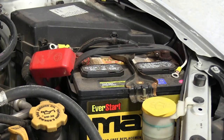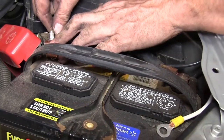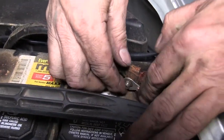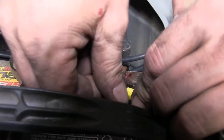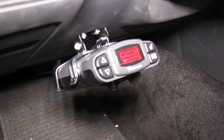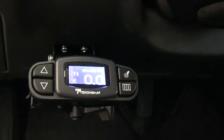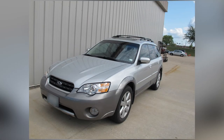When we're done with the interior, let's go back underneath the hood and make our final connections to the battery. Our two black wires will go to the positive side of the terminal, and our white wire will go to the negative side. To attach to the negative post, we're going to use an extra nut — it'll be a 6mm by 1.0 thread pitch. With all our connections made, we'll take a look at the brake controller — it shows power and no trailer. We'll go ahead and hook up our trailer; you can see it turns colors. We'll apply power and the number shows up, which means we've got a good connection to our trailer. That'll finish the install of part number 90195 from Tekonsha on our 2006 Subaru Outback Wagon.